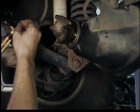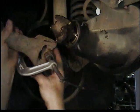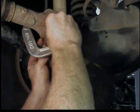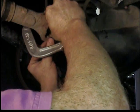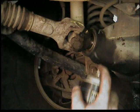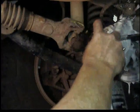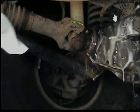Put the driveshaft back on, lined up the same with the yellow marks all lined up. Put the U-joint caps back on with the two bolts. Torque those — couldn't find the spec in the book, but they're quarter-fine so I went to 129 inch-pounds, which seemed about right. Then clean up the case — all that stuff that had leaked on it before — so we can spot if it's leaking again. I used a little degreaser, wiped it off, and hit it with brake cleaner and it came out real nice.